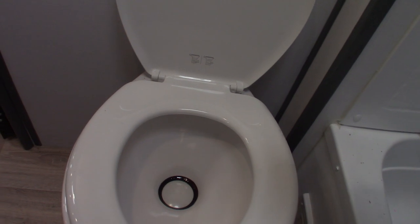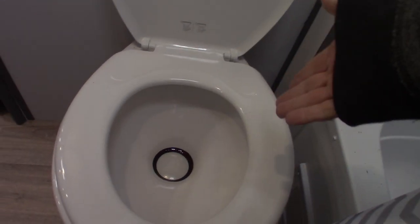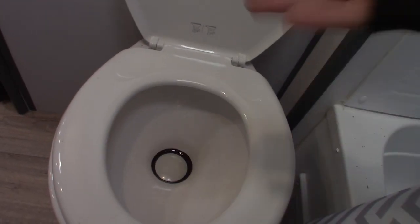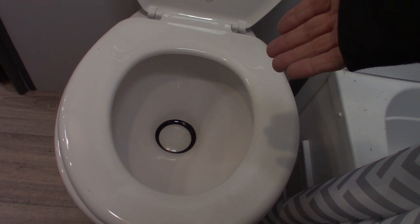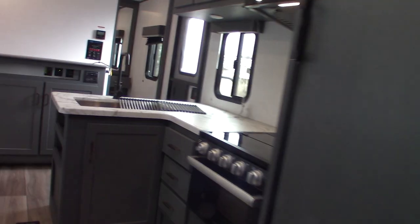Your toilet has a flush pedal on it. When you pull into the campground, hook up your power and water — your black tank is empty, directly below. Put a dose of chemical in the bowl and step on the pedal, hold it down so you put at least a gallon of water along with the chemical into the black tank below. Then you're all set to use it. You can't use it dry — without water or chemical. If you do, it'll get clogged up and the smell will be terrible. Always put your chemical and water in there.